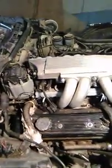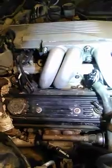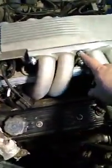Everybody, it's Dave again. I wanted to show you guys where we're at. We didn't have a problem with that bolt, these bolts all down in here. It's really hard to see, especially with the camera. There's one, another one's hidden there. Just remember there's 6 bolts per side on the bottom and one of those is on the inside. We got all those torqued up, and they're torqued to 18 foot-pounds is what I'm setting them to.